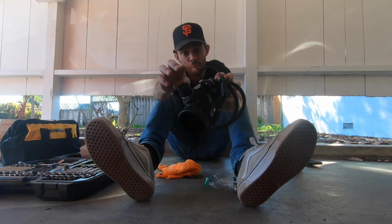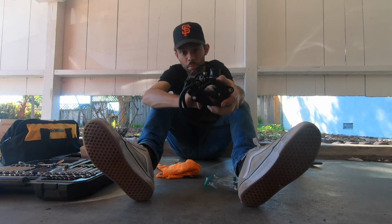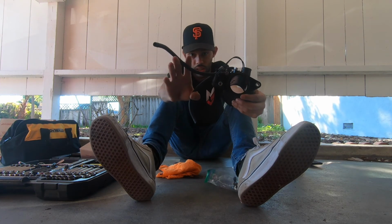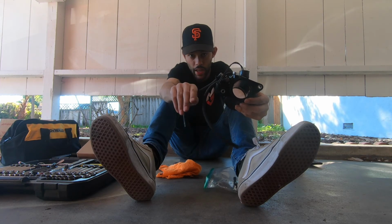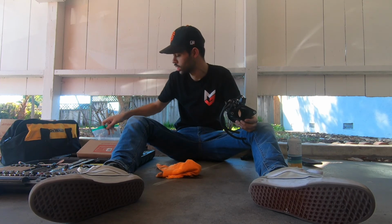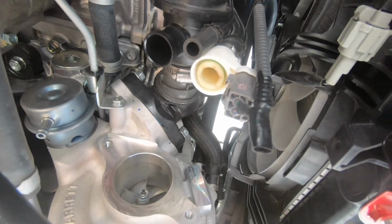2 tapping screws, port inside the turbo inlet, and then we can go back and put it in. This will go to that connector that we took out, and these will go to turbo and wastegate. Save your stock parts.